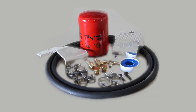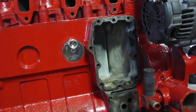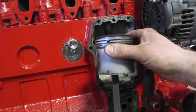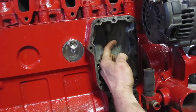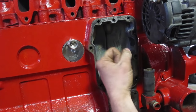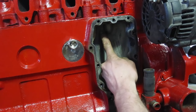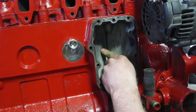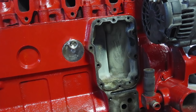Your coolant filter doesn't actually filter your coolant — what it does is put a little film on the cylinders. As your piston comes down on its power stroke, it's actually vibrating in minuscule forms, pushing your coolant away from the cylinders and creating an implosion. If that film wasn't there, it would eat at the steel. With the film on there, it eats at the film instead and keeps your cylinders in good shape. This is called cavitation — John Deere engines were bad for it way back when, and coolant filters seem to take care of that.